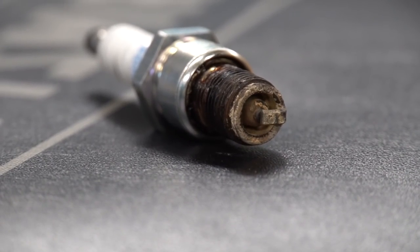At the end of the race I pulled the plug on the motor and it looked pretty concerning. I think part of it was due to not changing the plug for an extended amount of time and running 50/50 avgas and pump gas. So I'm going to pull the head just to make sure we don't have massive carbon build-up and see how clean it is inside.